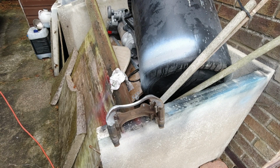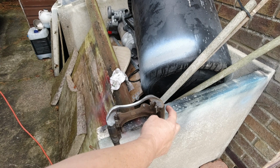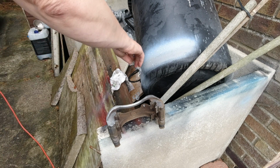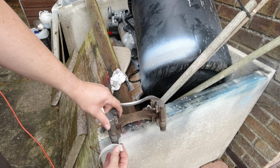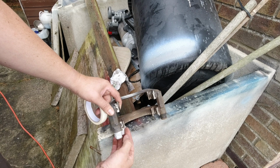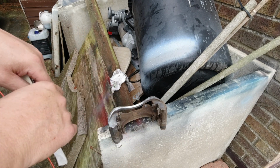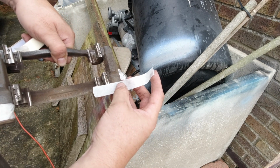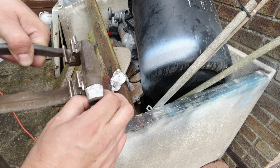as ever, round up my little rough spot where I do my spraying. The only bit I'm really interested in spraying is this and here, because that's all you can see from the wheel side. But I want to just mask off the two little rubber boots on the sliders, little concertina gaiters, because paint doesn't do them any good. Solvents in it can start to harden the rubber. So just mask that off, even though I'm not going to be directly spraying on them.